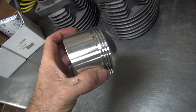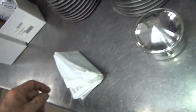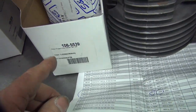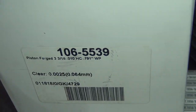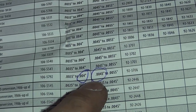These are the S&S pistons we're going to use. They've got some new numbers they're using now — looks like the same old piston, a Wiseco piston it looks like to me. They didn't really tell you what numbers they use because they don't list it. These are standard 10 overs because these are brand new cylinders. They say right here you run 3.5 to 4, and 4.5 to 5.5 if you run it hard. So I decided to go right in the middle — 4.25. He's going to run it pretty hard, so it's a good starting place. If you break it in, it should be good.